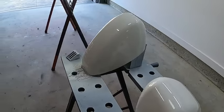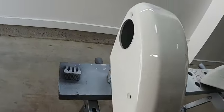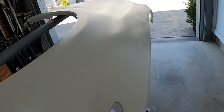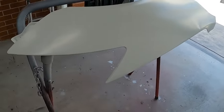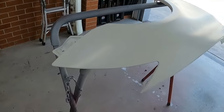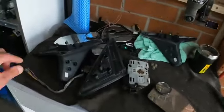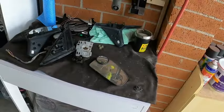Voila - clear coat painted. I used normal Super G photo clear because it's the same brand, that's why it's working. I only painted this one - this one still remains with the base coat. Under the light you can see some dents - I tried my best to remove and repair them. It might need a bit more primer and a bit more paint after we sand it, but so far I've got a good canvas and this area is protected - no more rust. Time to get the actual silver ones because I need to paint those areas black, and that should conclude this. Then we just need to assemble the mirror.